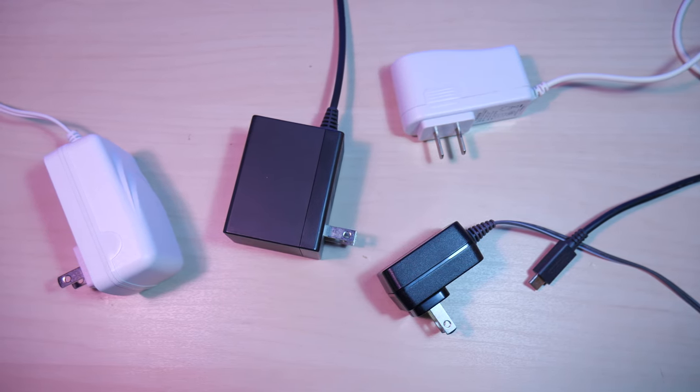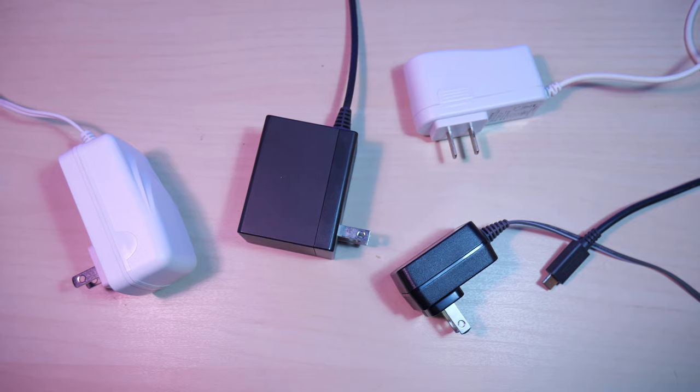If your setup is just a modem router combo or all devices are close together, you may decide extended parts of your network aren't really essential if you lose power. For a UPS protected modem router setup, that'll keep your internal network online, maybe also keeping internet connected if the closest hop is still getting power outside the network, outside of your house. If not, at least you can still access network attached media in your home as long as it's battery backed up.